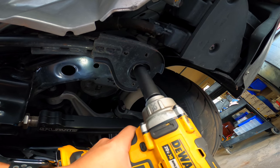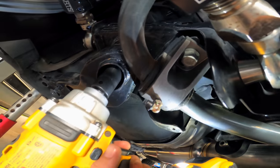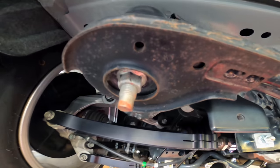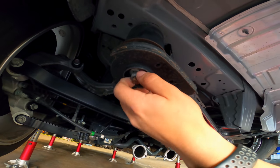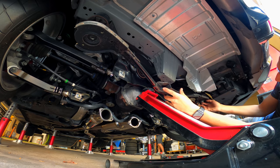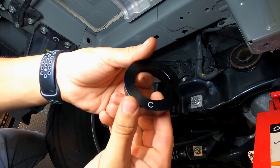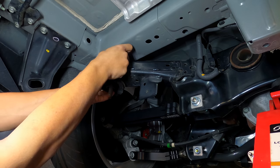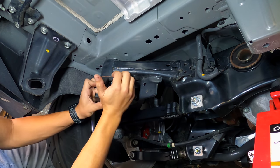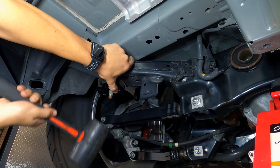Using a larger impact gun with a 19 millimeter socket, loosen each of the four subframe nuts incrementally so the subframe lowers relatively square — don't go full send on one side then the other. When lowering the rear section, an extra rear brace may need to come out, held by 14 mil bolts. If you fully remove the rear nuts, support the subframe weight with a jack. Beginning with the rear of the subframe, slide collar C on top of the rear bushing with the opening facing toward the outside of the car. Then spray some silicone lubricant into the lower portion of the bushing and tap collar B in with a rubber mallet — it's a tight fit but doesn't need to fully seat yet.